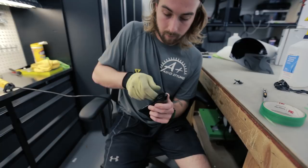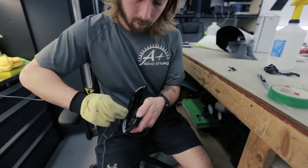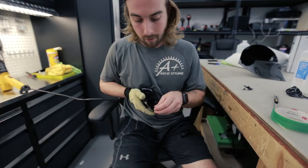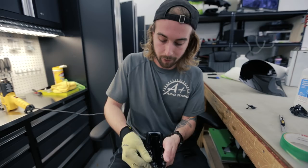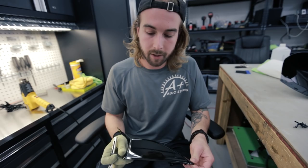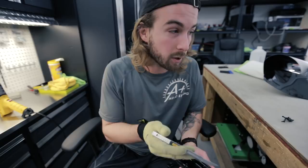I'm going to go across the tip and make three cuts. Fold one side in — you'll see you have two little tabs. Grab one tab, pull it, and stretch it around far enough so that little crease is not seen. Do it one more time and then a third. From the top it looks perfectly fine and clean; on the bottom it's folded over, but you can trim that up. That's the best way I found to do it. Now everything is tucked and folded around the sides — you're ready for a final trim. You don't need much excess left, especially with that rubber piece going back on.